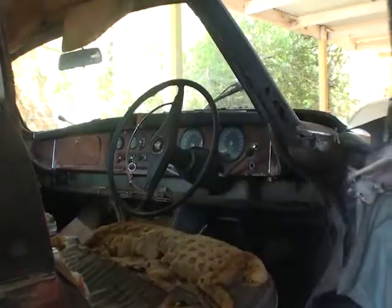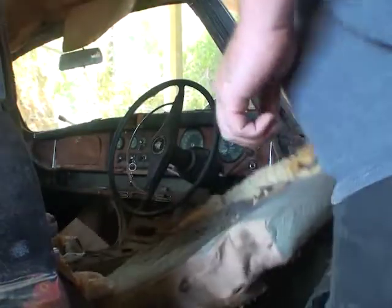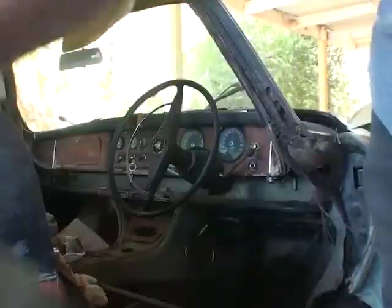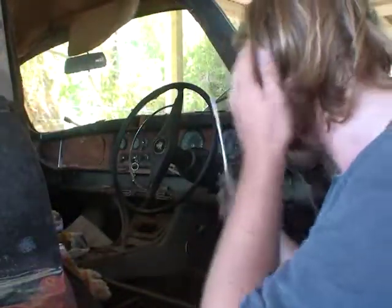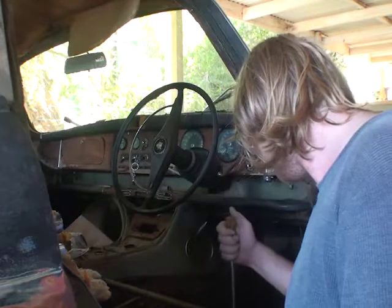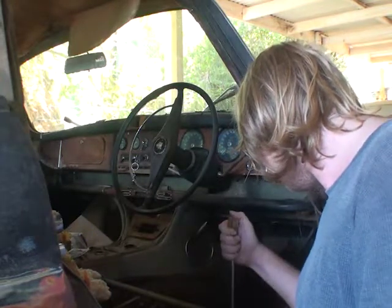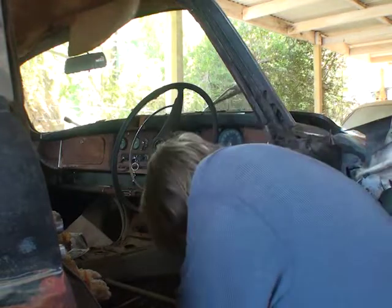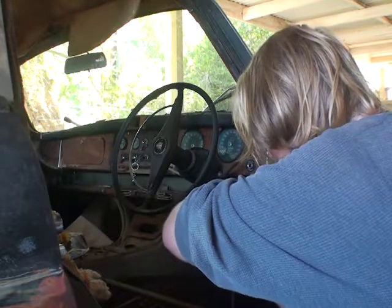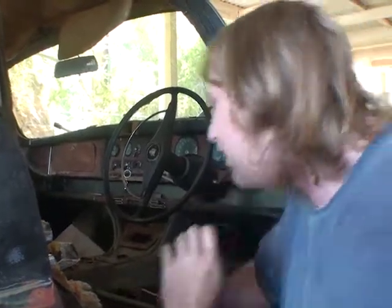The beautiful thing about Jaguar is that you can just take the cushion seat out. Since there's no fasteners, it's just press-fitted into the seat frame. You can just remove the seat with one of these — that's pretty groovy. The seat frame is just exposed once you take off that seat cushion. So we take a flathead and just go... oh, it actually came out. That's great. I have trust issues with slot screws. Let's take out the other one.